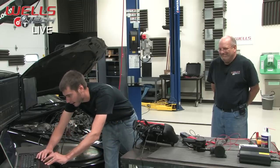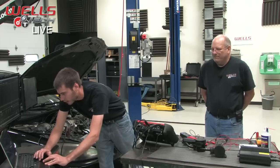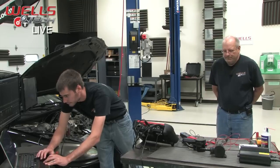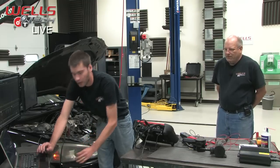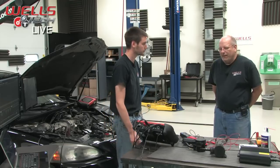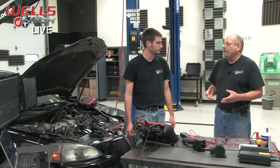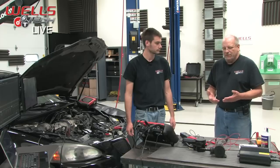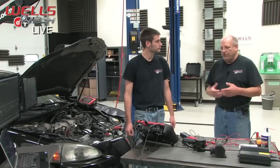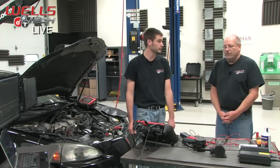And then we also have Randy Charlton here asking, is the car on or off? That's a great question. If the car is off, then it would be open so that you could fill the gas tank. He said Tech B also. But when you start up your car, it isn't like it energizes it and closes off that vent. The only time that vent actually closes is during a monitor test, when the system is checking to make sure you don't have any leaks. Great question, but you did answer it right with Tech B.